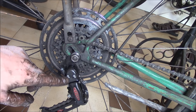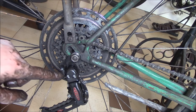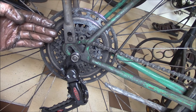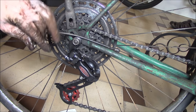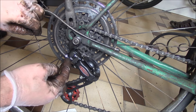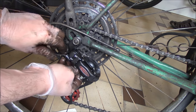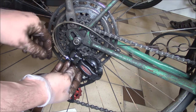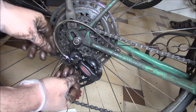There are tensioning screws to set the level of the derailleur. As you tighten and loosen them, the derailleur moves in and out, so you want to make sure it's even with the chain. Now I'm going to install the gear cable — just slide it right through here. Pull it out in case it's retracted too deep.